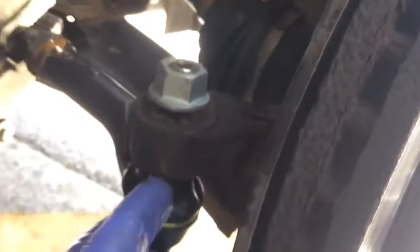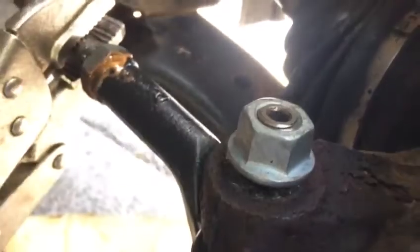We use the spanner to tighten that one. If you start turning from there, you've got a little allen key on the top but you cannot use the socket, so you hold it with the allen key and turn it with the spanner. In this case we hold it up so it sits properly, then we tighten it, then tighten the other one in the back — job done. Offside front track rod end. Thank you for watching, till next video, bye.